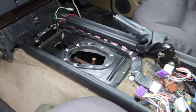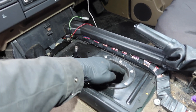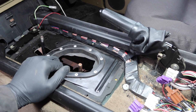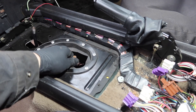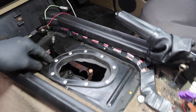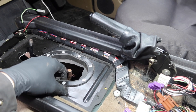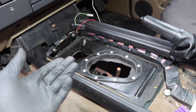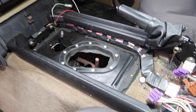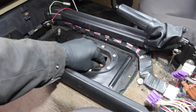The most minimalistic way of doing it is just literally cutting a hole in the gear stick rubber right around here, because that was just restricting the end play. I've already butchered this before putting the diff lock linkage in, but I will be sorting that out at some point and riveting it back on — I actually have a rivet gun, I just haven't got around to it. One of those things — it's like owning a Land Rover, basically. But now the gear stick's got all the play it needs.